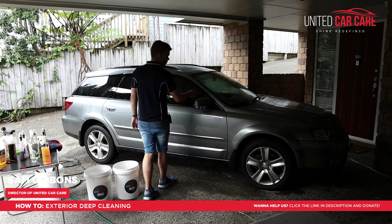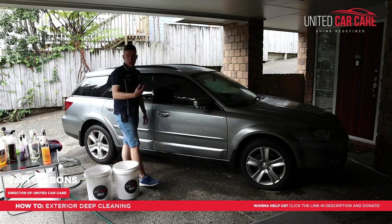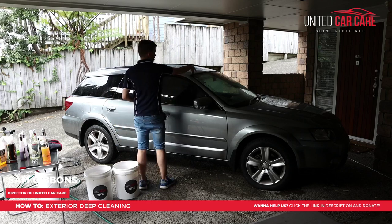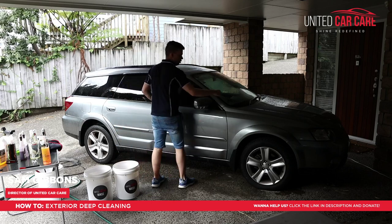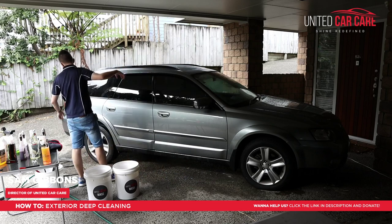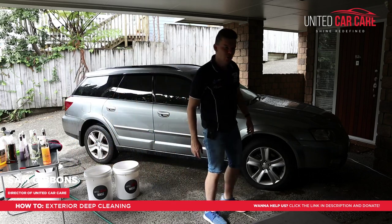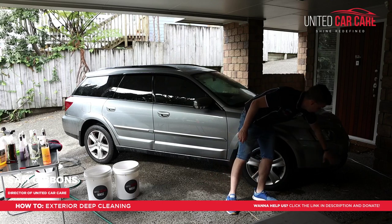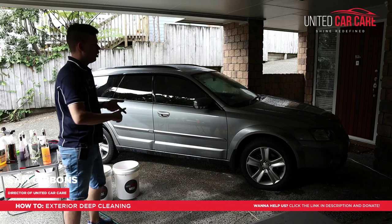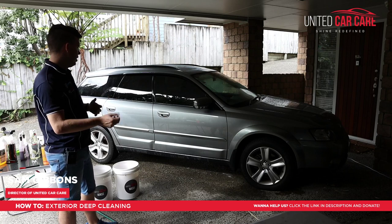The process that I've just done with these trims, the side skirts, and that wiper cowl, repeat that process for anything that is an exterior plastic or rubber, okay? So this around the windscreen, I will do this on this car, just not right now. Do it with that, do it on these. There's the mud flap at the back, do it on that. On this car, can you see it on that camera angle? Not very well because of the light, but there's a plastic right along the bottom of that front bumper. So scrub all that. You want to use the citrus pre-wash or the orange degreaser, depending on where the overspray is going to go and how you're comfortable with it, to clean that.